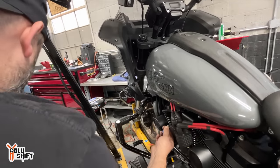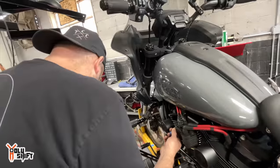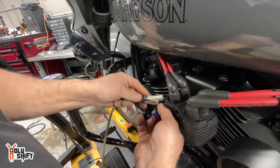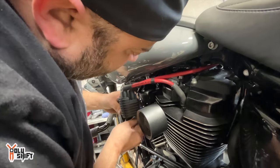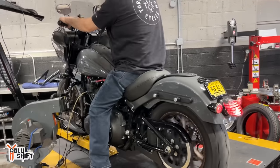On the left side, we're getting our tach signal off of the ignition coil for RPMs — it reads the pulses going into the wire. On newer bikes it's the green wire, so we're going to clamp onto that. That gives us our correct pulse. You do have the Love Jugs installed, which makes it a harder reach. We're going to do a base pull just to see what the Fuel Moto base map is giving us, and from there every graph we're going to record and save.